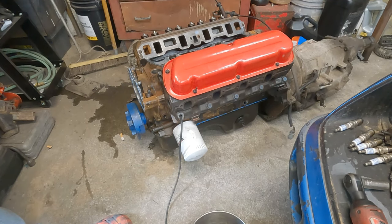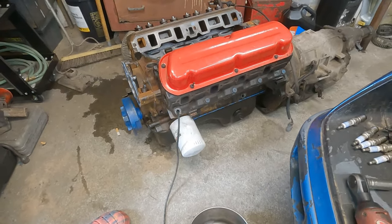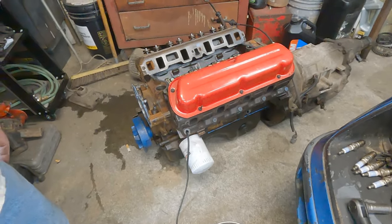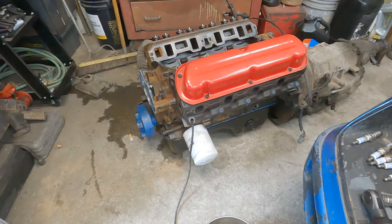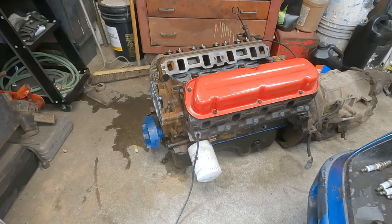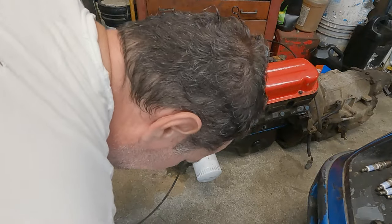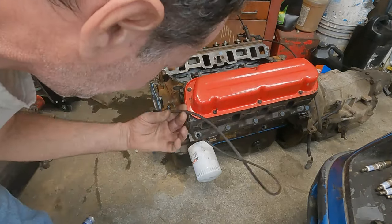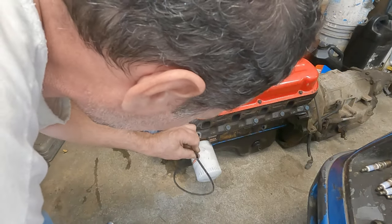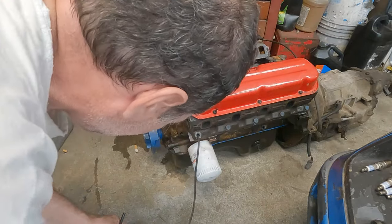Anyways, when you're pulling the intake off, or the head, or whatever, normally you get water in the motor, and your oil, it changes the oil, do all this drama. Just pull one head bolt out, as they go into the water jacket. I took this, it has come off of a bucket. It's got a hole in the middle of it. It's basically a vacuum line.